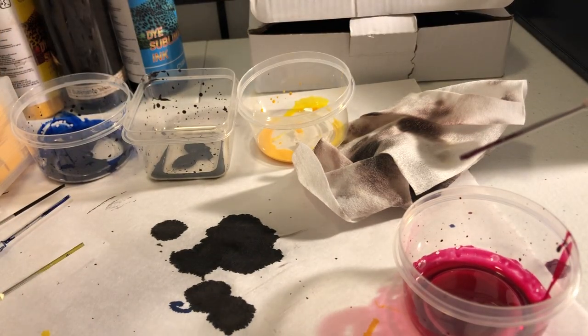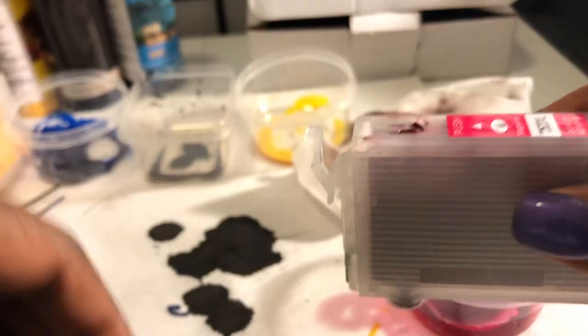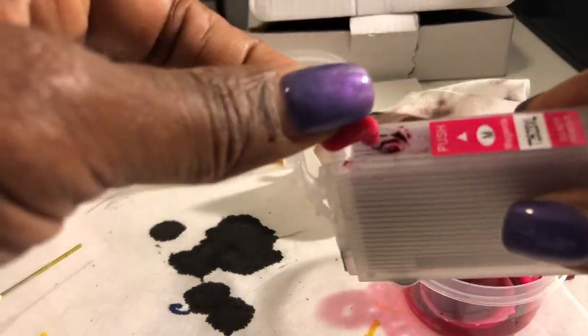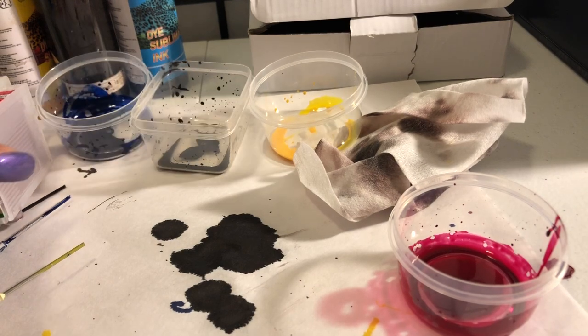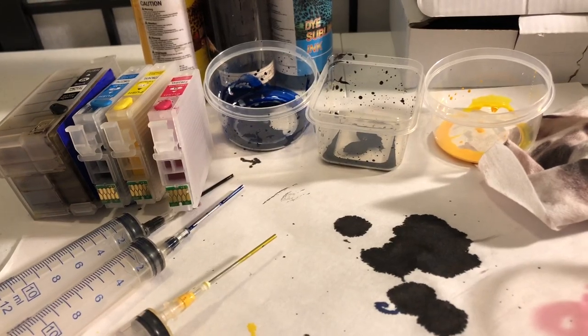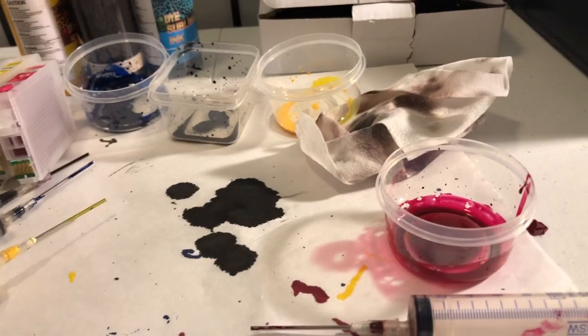I think that's good enough. Now that I'm shaking it, it's covering up — you really can't see. That should be good enough for right now. Like I said, the printer won't tell you when the ink is low. The reason I found out my ink was low is because ink was splattering on my paper when I was doing a project. So just keep an eye on it and change it when needed. You can also turn off your printer and just check on the cartridges — you can see the levels. This is my mess I made, so don't be scared to make a mess.